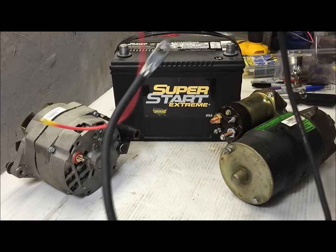Number one position excites the alternator; when the alternator starts charging it shuts the light off. If this light does not shut off, the alternator can still charge but it's going out and going to start giving problems. When I was testing the other day the light would go off and then it wouldn't, and it would charge then it wouldn't — something in there is failing. If that light stays on, go get a new alternator. I hope you understand a little bit more about what's going on to run that alternator — it's very simple. Ask me any questions, thanks for watching.